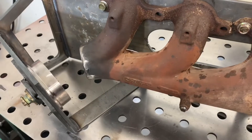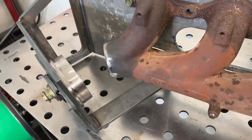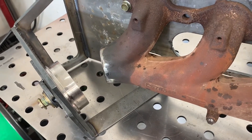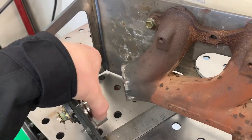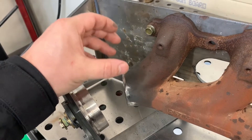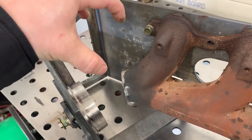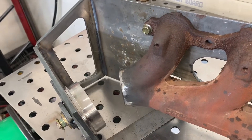I fitted the manifold to the fixture, then took the manifold out, got rid of those pieces of metal, got the v-band cleaned up, and the manifold cleaned up. I'm going to start making a transition piece that goes from here to here. Then we'll bring another pipe off of here and put a v-band for the crossover to go underneath and around the back of the oil pan. That's where we're at.